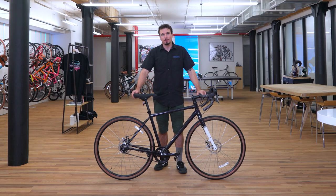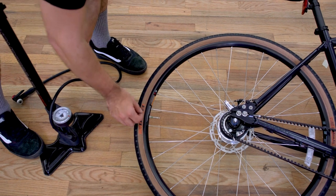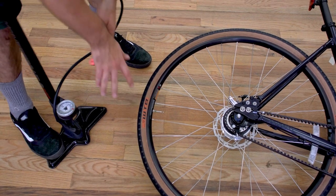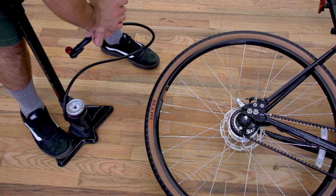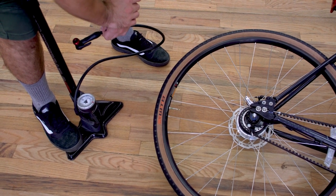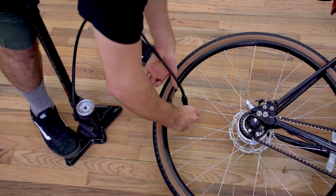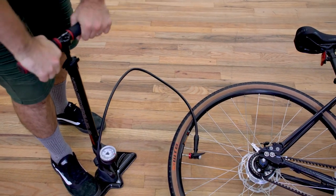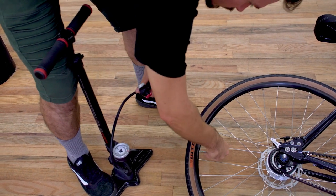One last step is to air up the tires. Remove the valve cap — this is called a Presta valve, so in order to put air in you have to loosen the tip just a little bit. The pressure range for these tires is 30 to 60 psi. If you're a heavier rider doing mostly road riding, you want to be in the high 50s or even at 60 psi. If you're a lighter rider or doing more off-road riding, I recommend right around 40 psi. Clip the pump on and air it up, then remove the pump, tighten the tip of the valve back down, and reinstall your valve cap.